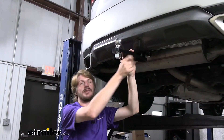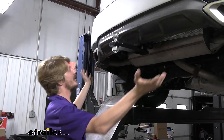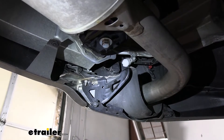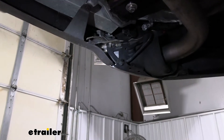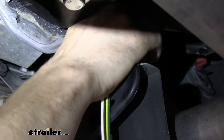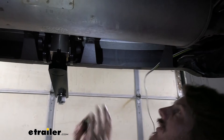Next we'll need to get our wiring set up so that way when we are pulling a trailer we've got all those necessary lighting signals. Our vehicle here has a factory tow package and the wiring that comes with it plugs directly in, so it's an extremely easy Stealth Hitch to install to get your whole Lexus ready for towing. The wiring is super easy because there's our connector right there — we're on the driver's side at the very back corner just above our exhaust pipe. You can see the white cap right there. We're going to press in on the release tab and then remove the cap. We can just set that aside — we won't need it — and then we'll grab the wire harness that comes with our kit. This is going to have a custom fit connector that's going to plug directly in to that factory connector there. So we'll just simply give it a click, and then we can take our wiring and bring it over to the center of our hitch where we can secure it with the included zip ties.